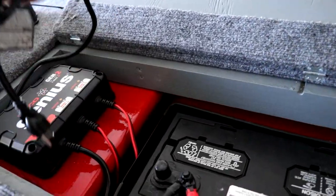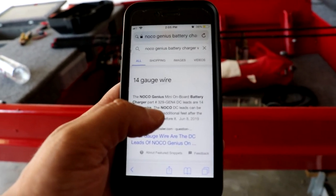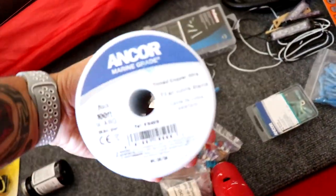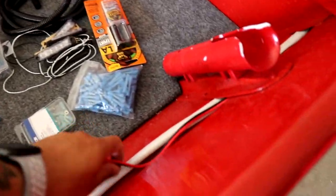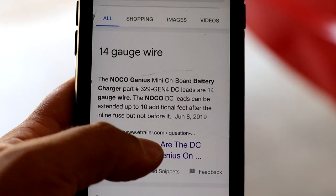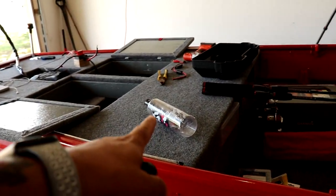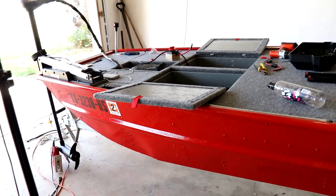After some research, great news: the Noco Genius onboard battery charger uses 14-gauge wire, and I have 14-gauge marine grade wire here — it just looked bigger when bundled. Even better, Noco states the DC leads can be extended up to 10 additional feet after the inline fuse. I only need to extend mine about six feet, so I'm good to go. That makes me very happy.